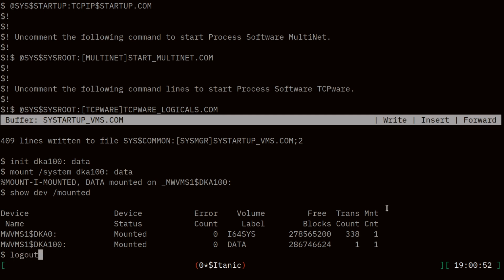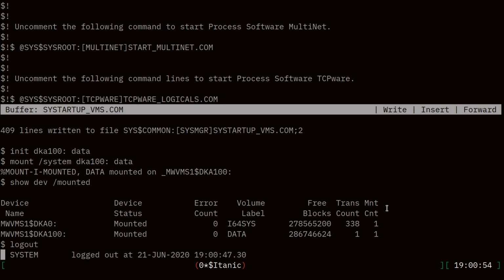I will log out, and we'll consider this a successful base installation of OpenVMS and TCP/IP services on our Itanium server. Probably in the next video, I'll show just how I do some basic customization of the system to get it into what I consider kind of the minimal usable state for me. And then that video will also be pretty applicable to VAX and Alpha VMS installations. So that may be more interesting to you if you don't have an Itanium system to run through this initial installation on.